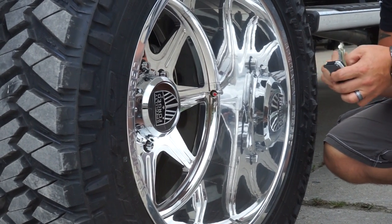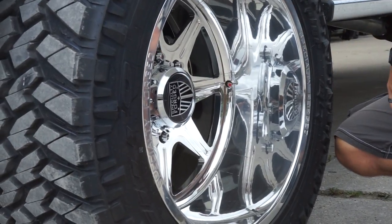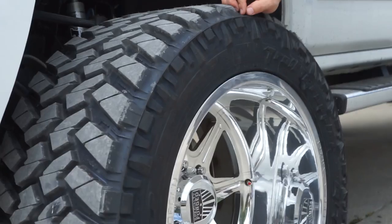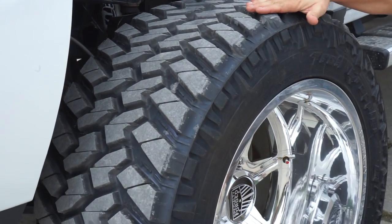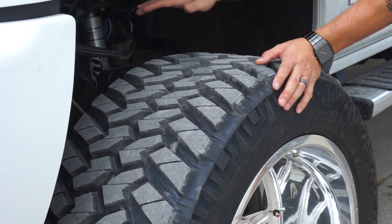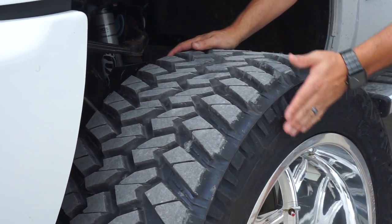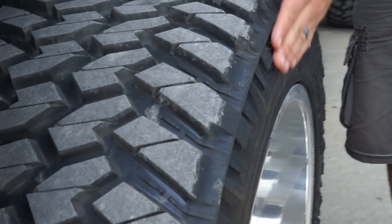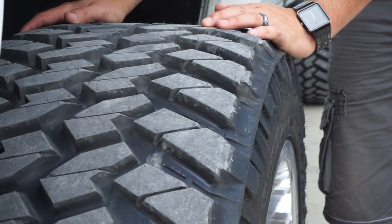It's about time to clean these up because we drove around the block twice. The tires are wrapped in a 375/45R22, which is basically a little over a 35 and almost 15 inches wide, so it's gonna give it that big, huge, wide stance. It's also gonna create a nice straight up and down sidewall on that 14-wide, so you basically get that real square-looking setup.